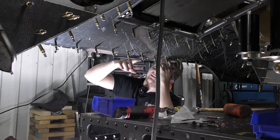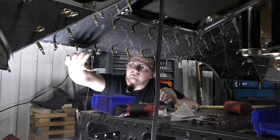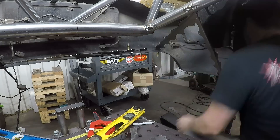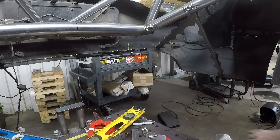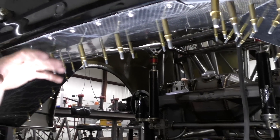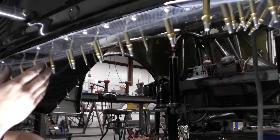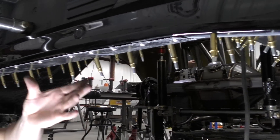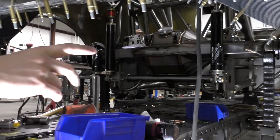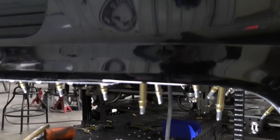On the inside I've got some scallop strips going along here, and then we have some with a flange on them. So I flanged it and it's bolted here on the bottom of the bumper in a few spots. I nut-certed the rest just to hold the panel up to the bumper and stiffen everything up. The bumper is actually very rigid right now with everything holding it — between the scallop strips, the carbon panels, and everything — because the carbon's tying into the back half where scallop strips are holding it, and then the scallop strips on the side add a little bit of rigidity since they're metal and bolted on.